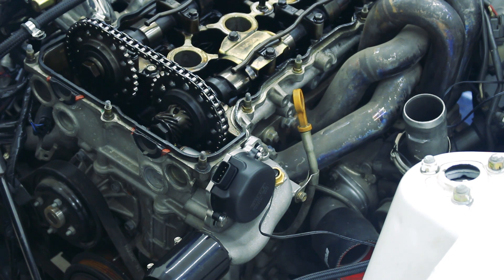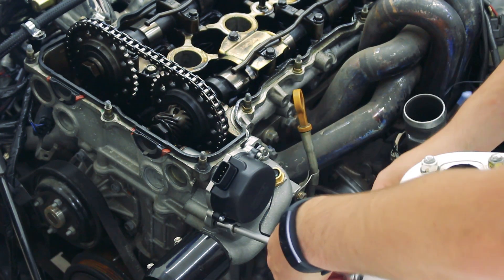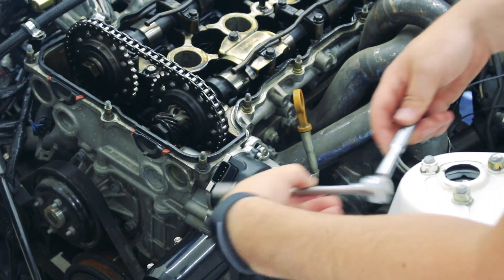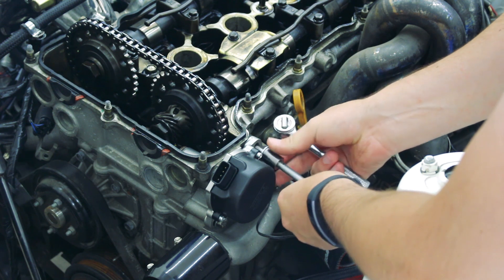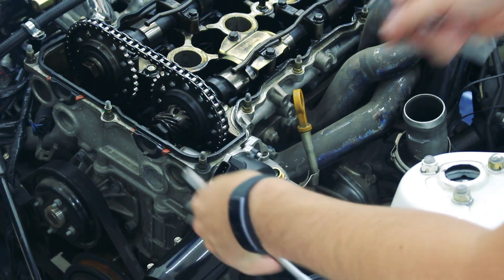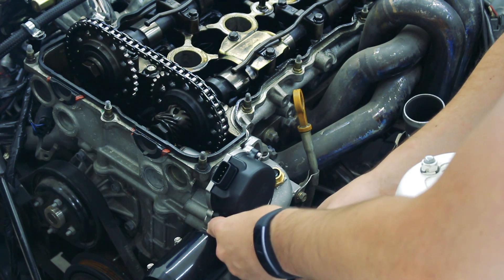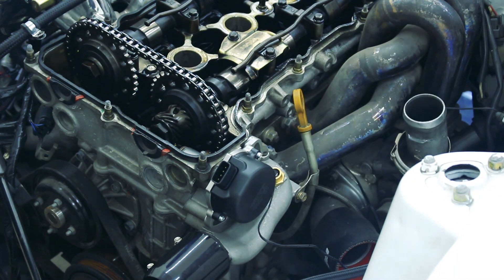Once you have everything aligned, it's time to remove the CAS. Do this by removing the two M8 1.25 x 20-millimeter bolts that hold it in place. My washers and bolts are not factory — there should not be separate washers involved, but mine was missing the original hardware, so I needed to use these. The correct hardware is probably a larger broad-head flange bolt without a separate washer or with a captured washer. These bolts should not be overly torqued and should be easily broken loose with hand tools. Do not hit them with power tools and do not turn them in the wrong direction, as the head is aluminum and you could pull the threads out or break the bolt off.